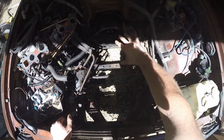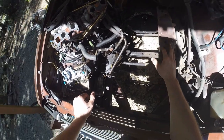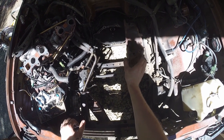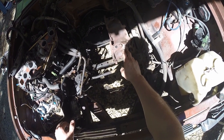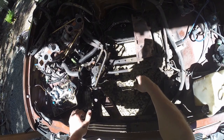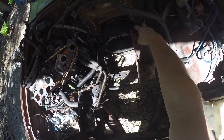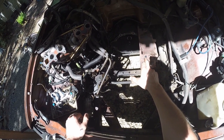I'm going to keep the stock exhaust on it for now. I'm not going to put the heat shroud stuff around it anymore because those bolts weren't on the studs all the way — I think partially because the new head has shorter studs. The shrouding needed two different gaskets to take up thread space, plus the shrouding piece itself took up a tiny bit of mount. I've never had any issues just running the stock manifold without heat shrouding, so I'm going to run it like that and hopefully actually be able to tighten it down. Worst case, it's easy to put longer studs in after the engine's in.